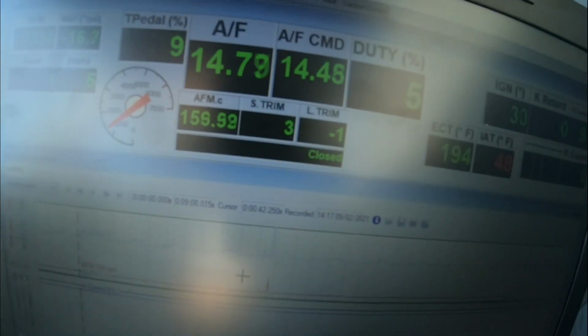And the fuel trims look excellent. Actually, look at that, negative 2, negative 1, which is perfect. So I don't know, was it an issue with the sensor not being plugged in all the way, causing inaccurate readings possibly? I'm really not sure. I don't know how just removing an O2 sensor and plugging it in changed the fuel trim so much. But we'll rock the stock AFM flow table again. If it works good, that's even better for me, because the other way around, we were tuning the AFM flow to compensate for something, which could have been a bad connection.